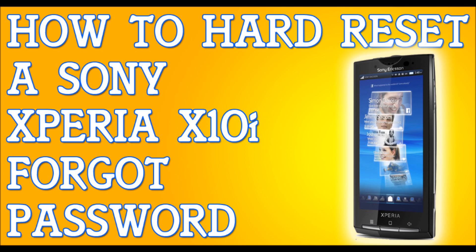Once the phone is turned off completely, we are going to be pressing and holding two buttons. These buttons are the left button and the right button, which are located under your display. Press the left button and the right button together and hold them down. While you're holding these two buttons, you're going to press and release the power button. Continue to hold the other arrow buttons until the menu comes out.